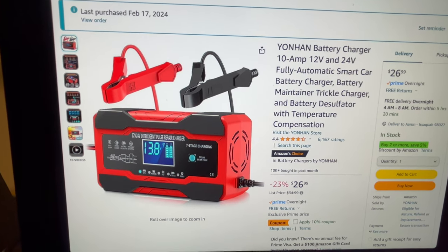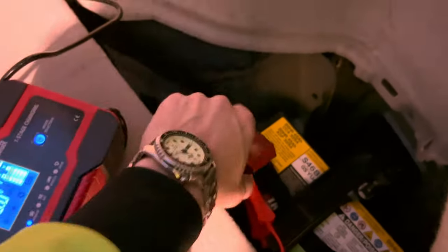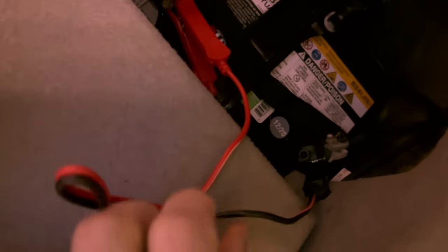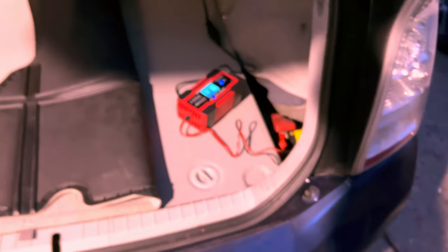I bought this as the small battery charger, but I got the big Schumacher 1304 for the Audi battery. We're hooked up to the positive terminal and clamped onto the negative. This battery was drained to 5 volts yesterday — I charged it up and then Meg drove it. But we need to give it a full saturation charge, because any time you drain a car battery, you always want to fully charge it.